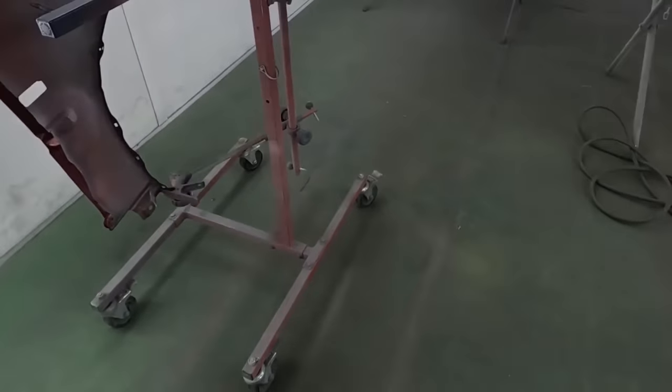On one of my last videos with Pedro, we actually painted the car together with two different hoses. So that's really gonna help us out. And the reason why is keeping that wet edge. You know, it's so difficult to paint a vehicle one person and kind of keep jumping all around to keep it in one nice, clean paint job. But we're gonna help eliminate that by starting at the top and moving down both sides. And we're gonna see how it works out. We're ready to spray that black right now, so let's jump right into it.